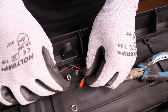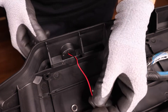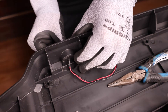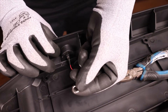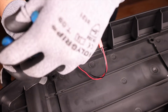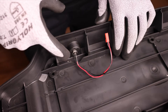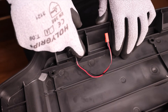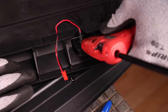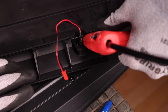Take our new charging port and insert it back into the hole. Take our nut and screw it in. We will now take a hot glue gun and re-glue the back side together. Apply a tad bit of glue all around just to hold the nut in place.